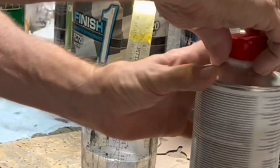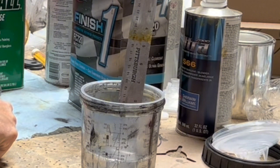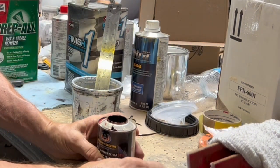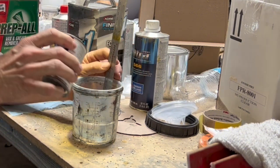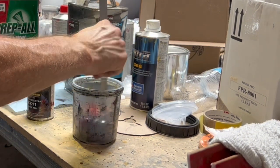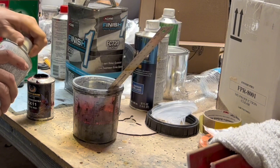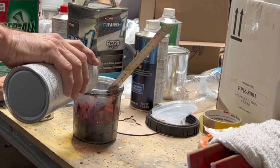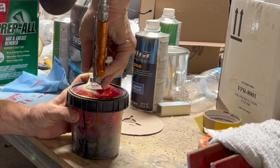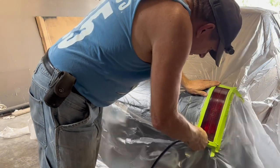I'm going to make sure to put a good amount of candy in because I don't want to put more than two wet coats on it. I'll put my fisheye coat on it, but I don't want more than two wet coats and make the taillights orange-peely. Here I'm putting in a decent amount of candy to make it colorful — looks nice and red. It's pretty hot today so I'm going to use a little slow reducer because I don't want solvent pop. I'm using the Astro Euro Pro Evo gun with a 1.3 tip.